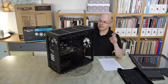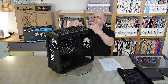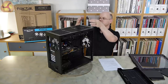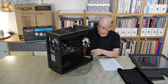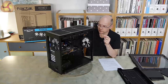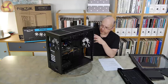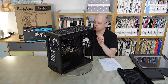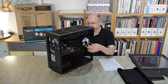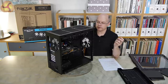The lack of air filtration on the top is something I'm not happy with. The radiator mounting in the roof is actually offset — you can see the row of fasteners shifted away from the motherboard rather than centrally located. That's a good thing: it gives you space when the case is laid down for working, making it easier to tuck cables and ensuring fans and radiator aren't fouling VRM heat sinks. It's a subtle thing but a good thing. The fasteners — for both the radiator and attaching fans — use small button-head Allen bolts, and they supply an Allen key. That's a nice touch.